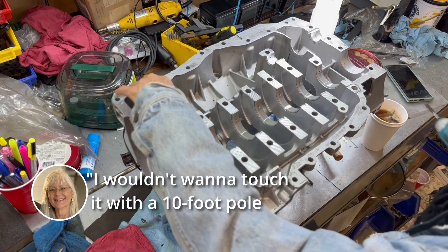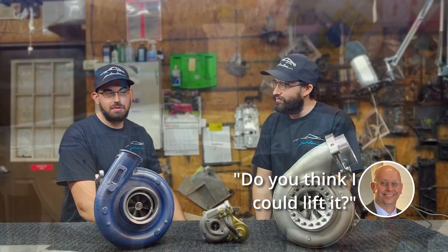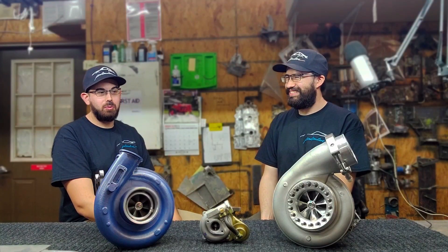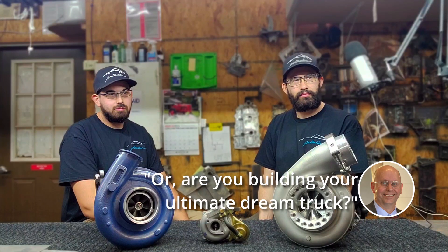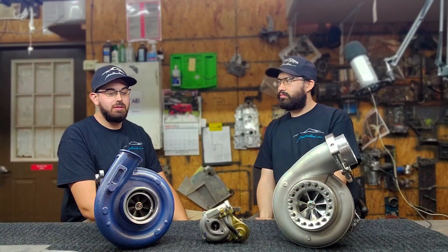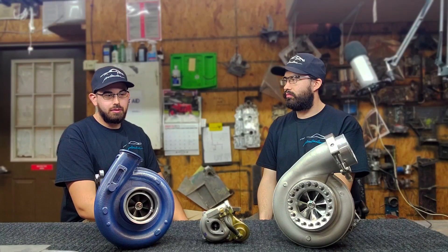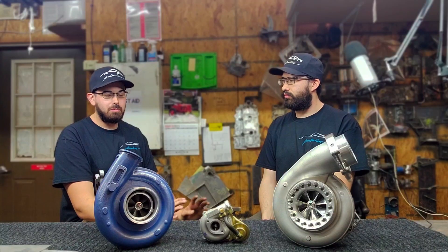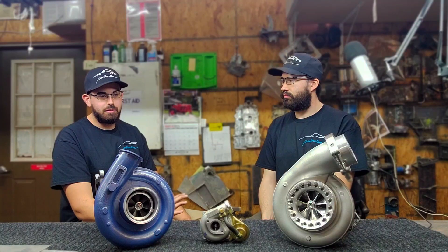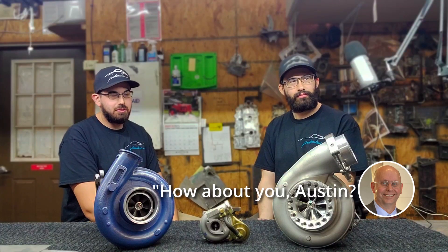As for engine building — I wouldn't want to touch it with a 10-foot pole, everything is too big. The cylinder head alone is about 170 pounds. For the ultimate dream truck build, I've got a Hamilton 220/208 towing cam, XDP 7/16 pushrods to competition spec, 108-pound springs, titanium retainers. The stock internals on the 5.9 Cummins are good for around 800 horsepower, so I probably won't touch the rods.